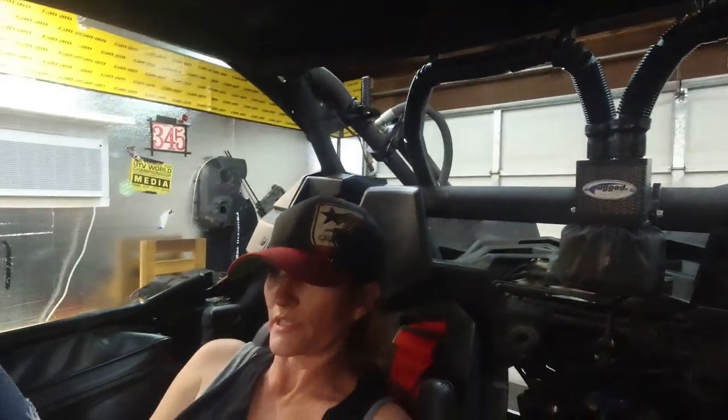So we went 3R to 3RI on 91. We're still on 91, but we have big injectors. So that's the next level. I mean, we're doing this in very small increments. That's how it should be done, right? In stages. So we have the big injectors, we have Evo full exhaust, we have a stage 3RI, and we're running on 91 octane.